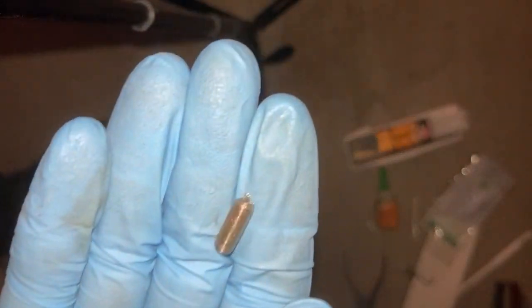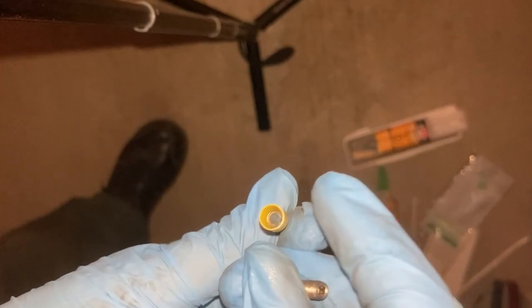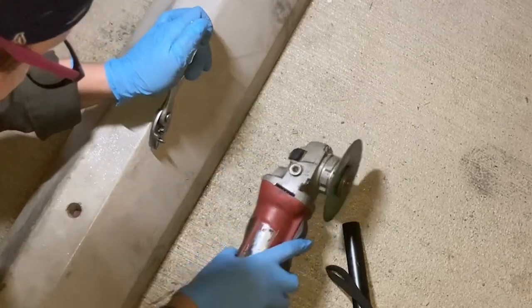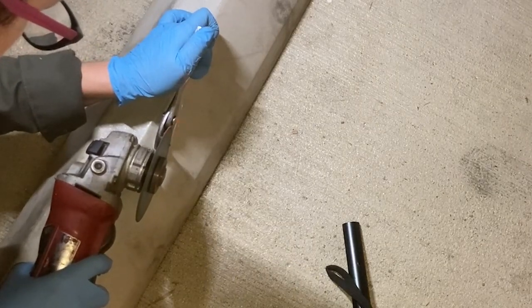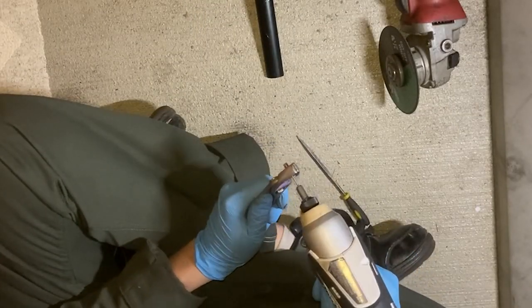I'm either going to use this, which has threads on it and I have drilled out, or I'm going to use this and cut this off. I really liked option A because the insert was just a tiny bit bigger than the hole, and with the threads I could secure it without any extra effort. It's just a threaded insert that has an allen key on one side, and I drilled all the way through it so that EVAP gases could pass through freely. I found it at my local hardware store. I thought it was a bit too long and didn't want to put too much stress on the tiny plastic piece, so I cut some of the threads off and made sure the center was still clear by running the drill bit through it again.